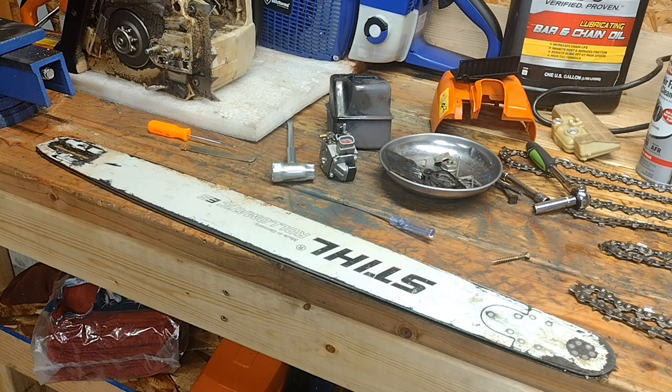There is no tack left in used oil that comes out of your engine, whatever you're trying to recycle it from — it's garbage. There is lithium added to bar oil to give it tack so it doesn't just fling off, and it gives it a higher shear strength. You're already running broken-down oil if you're running used oil — the oil molecules are already sheared and have no lubricating properties left.